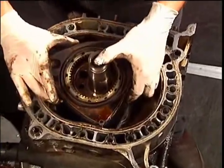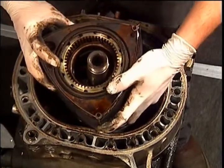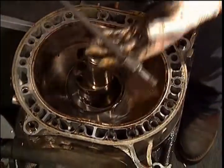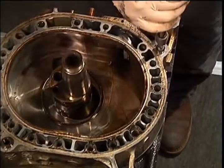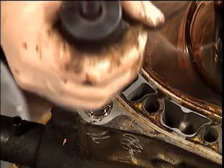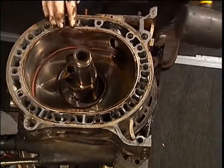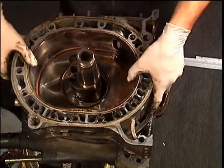Lift the rear rotor out and collect all of your small pieces that remained in the chamber or fell off the rotor. Use all of the threads on the dowel pin puller for removal of the alignment dowels. Note the lower pins near the exhaust are usually more difficult to remove. Don't be surprised if it takes some effort. With the 2 pins out of the rear rotor, tap the rotor housing with a dead blow hammer to get it loose, and then remove that rotor housing.